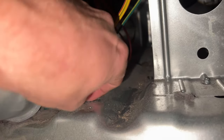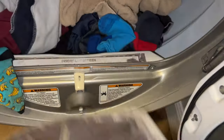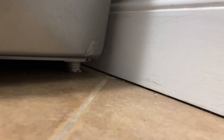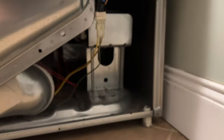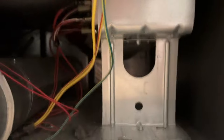Coins, paper clips, and similar items can easily be found in the drum and removed. To inspect the lint filter, make sure to unplug the dryer before doing so, then look down in the opening — if you see anything stuck in there, just go ahead and retrieve it. You can also open the bottom of the dryer by removing the screws and the bottom cover. Make sure to thoroughly clean the lint collected under there, as it can pose a fire risk with the heating element nearby. Remove any foreign object that could be causing the noise.